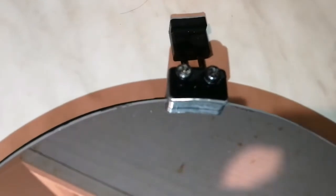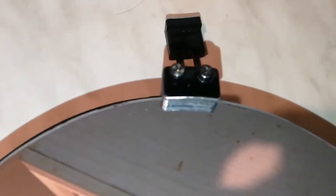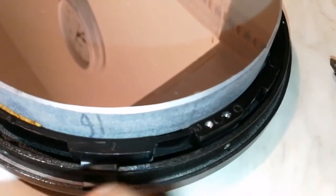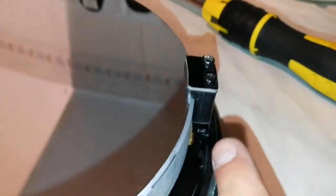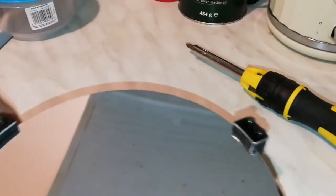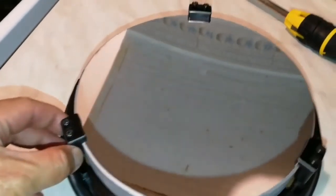So we are now going for doing the correct thing. You can mark them, you can even write numbers on the holder and where the mirror is. When you tighten it, don't over tighten these things because they will break. They are elastic in this part. The top part of it is a separate thing, which is rigid, but this part is elastic, made of rubber. And that's it. I have now done the mirror.